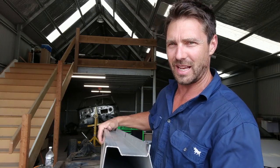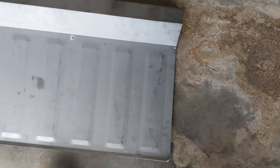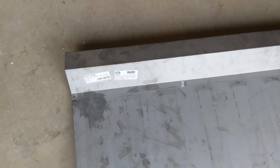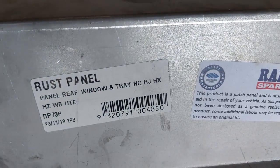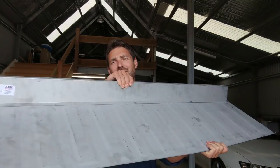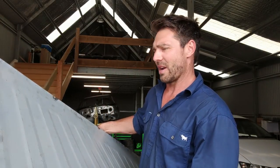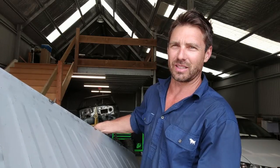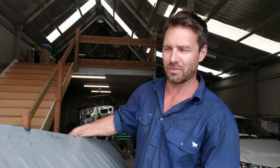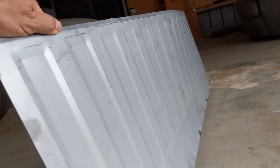From what I can tell, it creates that new lip for you, and the rear has that rear windscreen section. The tarp join rivet points will be along this ridge here, so you have to do a little bit of work to get it back in. It's all new sheet metal — to weld it in, you unpick the spot welds and put it in. This is a Rare Spares panel again. I have heard varying reports about how they fit — I don't know if it'll be like the cowl panel and fit straight on, because that cowl panel was an original pressed panel. I think this has sort of just gone off drawing, so it could be hard or easy to fit. We'll find out.